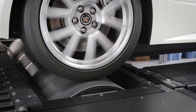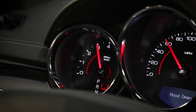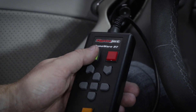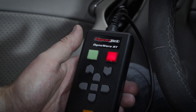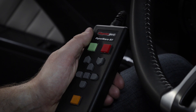This limits the slippage in the drivetrain and transmits the most power to the drive wheels. When you're ready, roll into the throttle all the way open and press the green sampling button once you're at 100% wide open. The status bar will say logging, the run timer will start, and the green indicator light will come on. Once the engine has accelerated to your desired cutoff, press the green sampling button again, then let off the accelerator. Press the red button to slow the drum down, watching the engine RPM gauge and pressing the button again to release the brakes as you near your RPM test starting point for the next run.